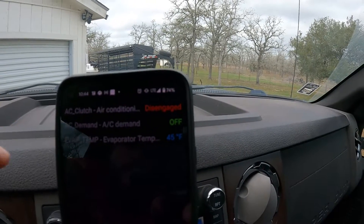It should not be that far off. One thing that's important for testing this is you want to make sure your truck is off and cool. I started it to move it over here to the shop so I was closer to tools, but the engine didn't get hot or anything, and it's been sitting for at least 20 minutes. So there's no temperature at all that should be skewing this evap temp probe. It might be a little bit different because it's up in the dash in metal, but it should not be that far off. I'm crossing my fingers that that's the issue.